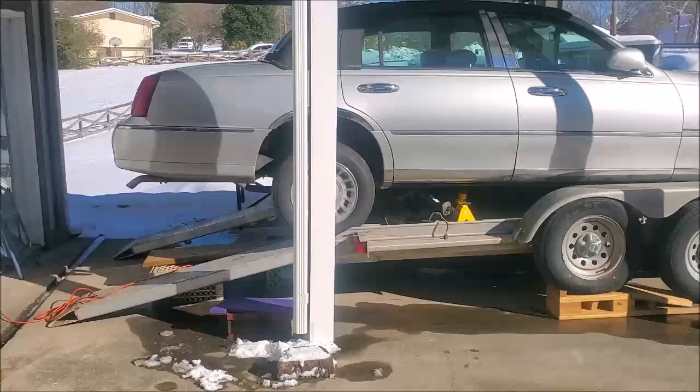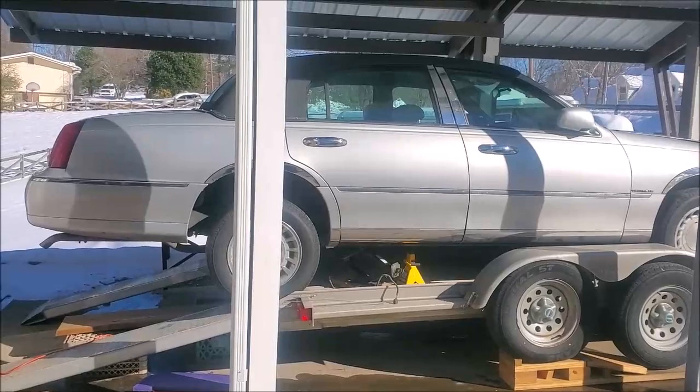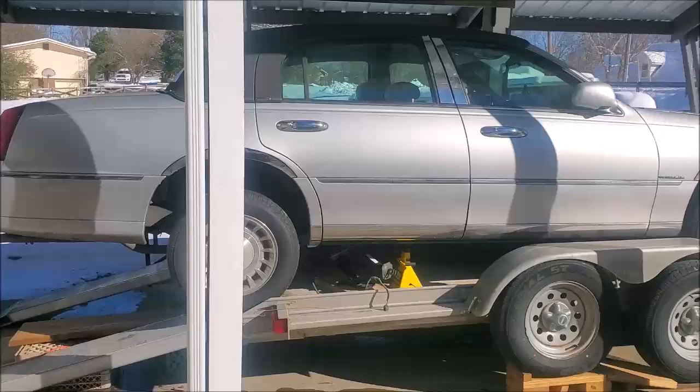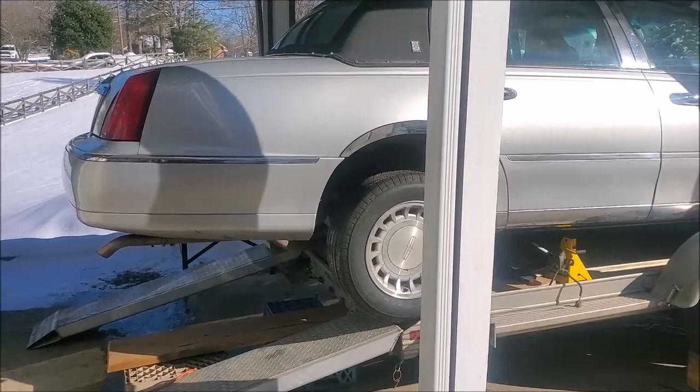Of the videos, only one or two actually alluded to this little trick. If you get this up in the air, jack up the body. In this case, I used a scissors jack, not from this car but from my motorhome, to raise the frame so that you have more clearance for the back tire to get to one connector that's for a sensor, a pressure sensor, I believe it is, on top of the tank.